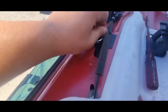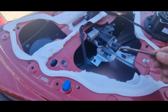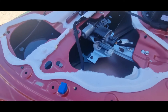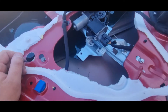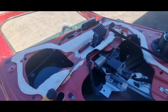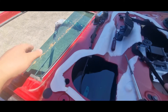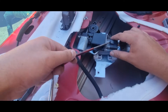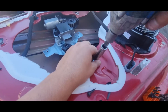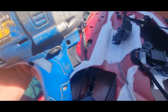Here I'm removing the inner cover that has a screw for the window regulator — there's a total of three of these and they're 10mm. We're going to detach the window from the window regulator; I think this was a T25 torx and there are two of these. Once you detach these screws, the window regulator and window are separated. If you're going to change the door lock actuator you do not have to do this — just skip to the part of the video where I'm removing the door lock. Next, unplug the window regulator and with a 10mm remove the three bolts for the window regulator and it will be completely off.